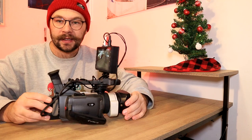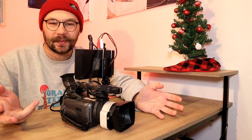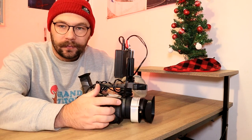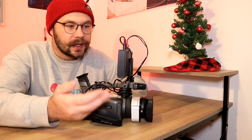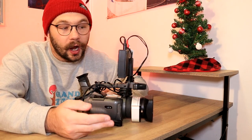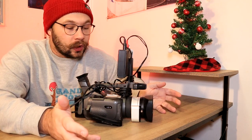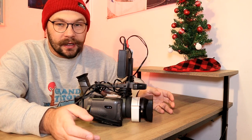You pretty much got yourself a digital Canon GL1 or a digital VHS camera. So that's a good way to do it. Now, it's not the best source of video by any means, because you're not using any form of FireWire. FireWire is a digital source, and S-Video and your AV cables are actually analog. S-Video — you do get a better image quality, but it's not FireWire quality. So that is just something that you have to look out for.